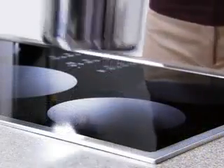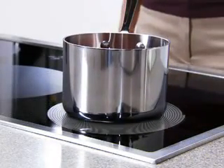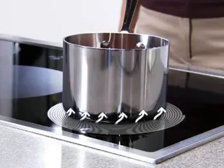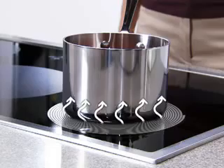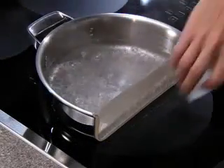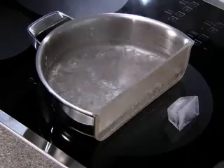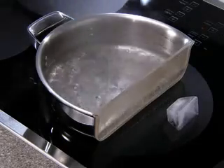It's actually very simple. When a pan is placed on an element, a high-frequency coil below the cooktop's surface creates a magnetic field. The heat generated through magnetic friction is transferred directly to the pan, which heats the cookware. Since the area right beneath the pan is the only part of the element being used, this cooking method wastes less energy than traditional electric or gas cooktops.